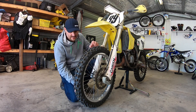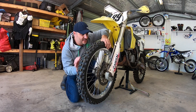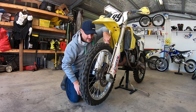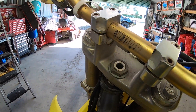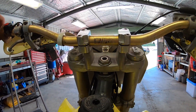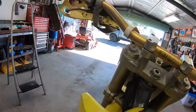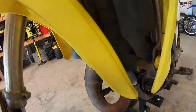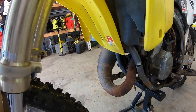I then move to the front of the bike and check the wheel bearings — they're surprisingly good considering the condition of the rest of the bike. I check that the wheel runs square, that the disc isn't bent, and that it's not rubbing. It's also a good opportunity to check the headset bearings — you should be able to move the forks with fairly much no pressure at all. You can hear a scrape, but that's just the guard hitting the broken radiator guard areas, which need replacing.